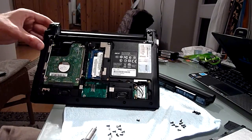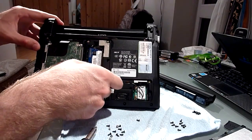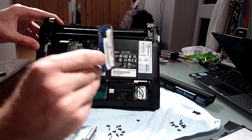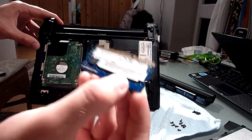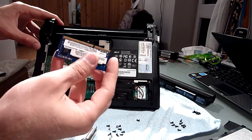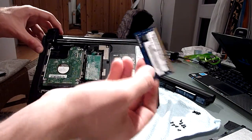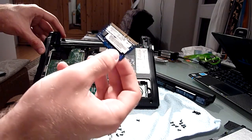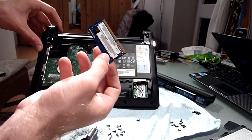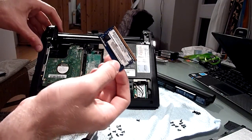Let's get started by upgrading the RAM. I don't have a DDR3 RAM stick with two or four gigabytes with me right now, but all you need to do is lift up the metal arms to the left and to the right and it pops right out. This is a one gigabyte DDR3 SO-DIMM — not DDR2 like on old netbooks. These two notches are not the same size as on older netbooks like the 1001P, so you can't put a DDR2 stick in. The processor supports four gigabytes of DDR3 RAM, so this one slot could potentially handle it.